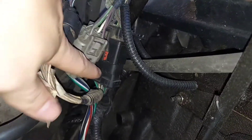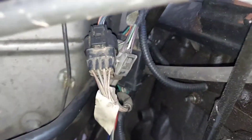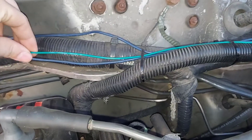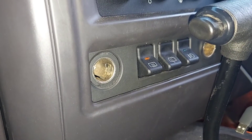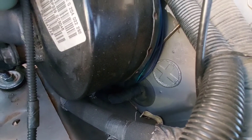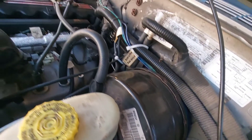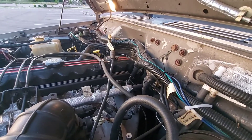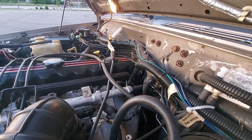If you want to keep your wiring clean, locate the transmission harness connector at the back of the engine bay. The gray wire from the ECU will connect to the bottom of this, so I simply spliced in a new pin and ran that wire to the dashboard toggle. From there, I spliced into the ground wire for the cigarette lighter. Some might argue to use a relay, and you totally can if you want, but it isn't necessary as this wire isn't really carrying any load — it's just a ground signal, so you don't have to put a fuse or a relay in it.